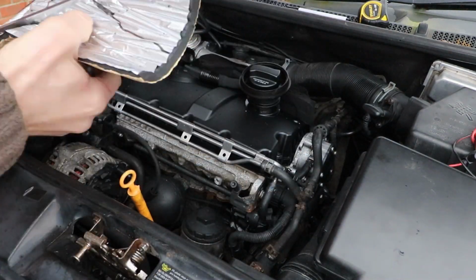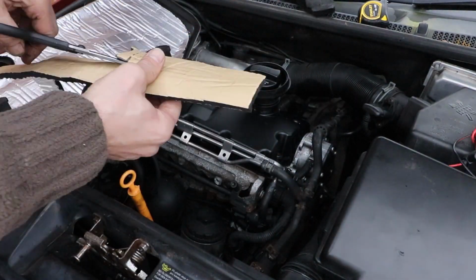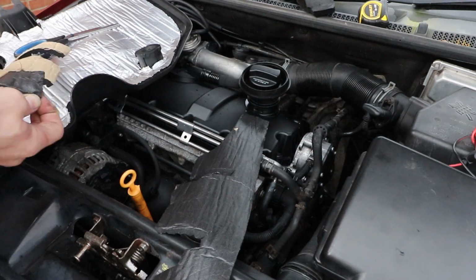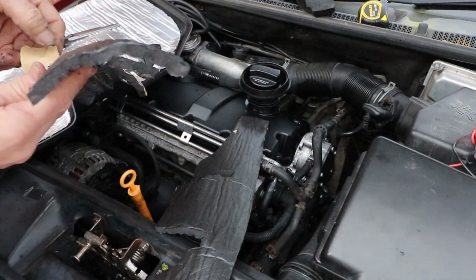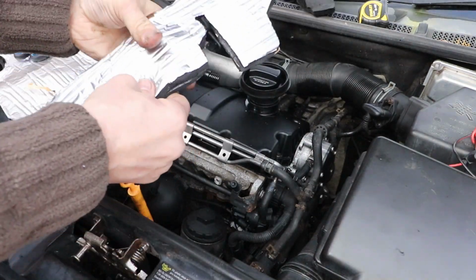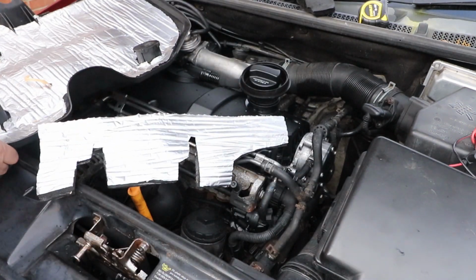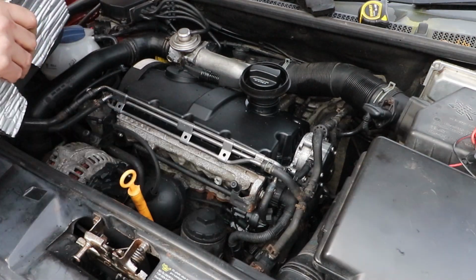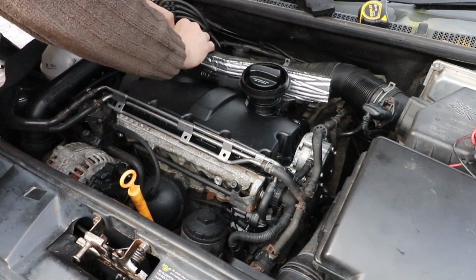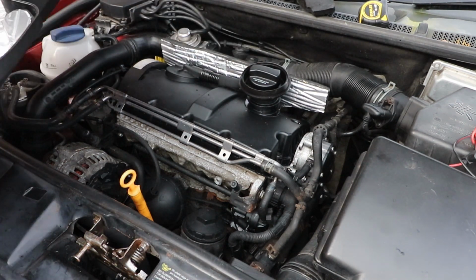For this piece, I cut two pieces and then stuck them back to back so it'll double the thickness and offer some heat protection on both sides. This actually worked quite well and just needed a little bit of extra trimming. Looks neat and very importantly dampens the sound from the rocker travelling backwards to the bulkhead, so I'm glad I've done that. Only time will tell if I get any problems fitting these.